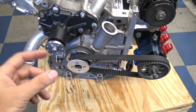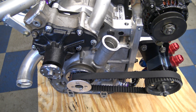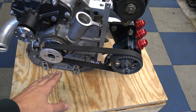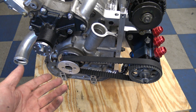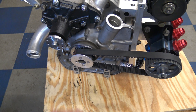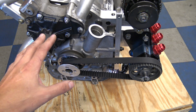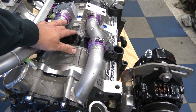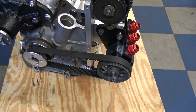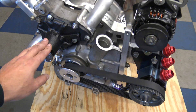Race bearings have a deeper oil groove inside them — the larger grooves give more hydraulic oil pressure and more safety at higher RPM. A standard four-rotor using just a wet oil pump like the factory oil pump is going to have issues, because that factory pump was made for a 13B, not a three-rotor or a four. It's perfect for around 7,500 RPM, but at eight to nine to ten thousand RPM it doesn't hold up — and on a four-rotor, you're trying to feed double the bearings of a 13B with the same small oil pump. In my opinion, you really need an external dry sump or a very large external wet pump to fully oil one of these at any real RPM.